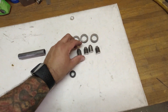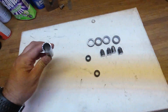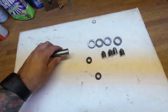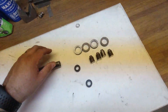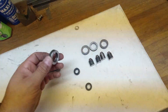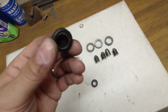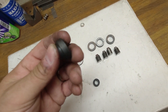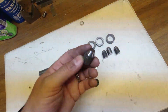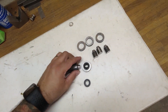All the parts are ready for the lower control arms. It's going to be longer than this pipe — 20mm pipe. I'm going to make some triangles because I can't just have a 20mm pipe; I'm going to have to strengthen it. This is going to be the bearing house. I found this pipe that fits perfectly over the bearings — or bushings, whatever you call them. I'm going to press them in, then weld on these little stubs and put them in the pipe.